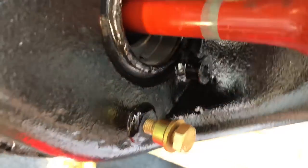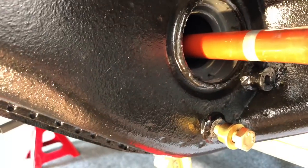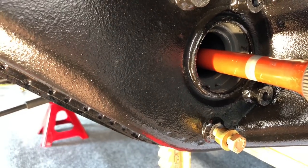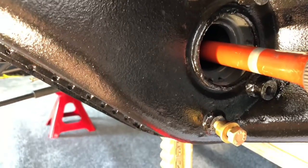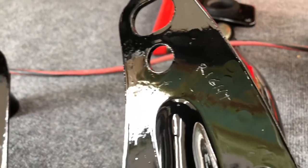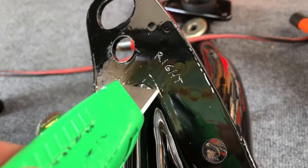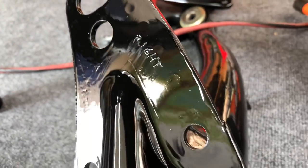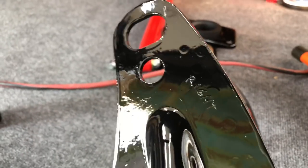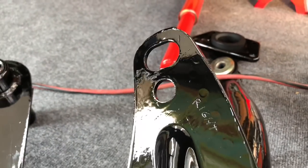The main problem here is going to be this bottom bolt and stud. I'm going to set my free swing angle and it's going to walk down into this area, so there's definitely a right order of assembly to make that work out without special tooling. This little patch right here was cut in with the tip of a utility knife before I loosened those bolts up. If I get right back on that mark, I should be real close to where it needs to be after reassembly. A little bit of scribing before disassembly — a big help.